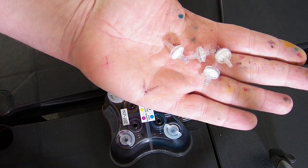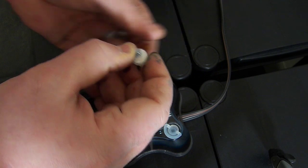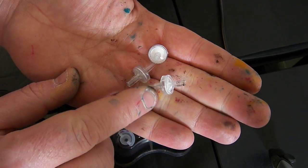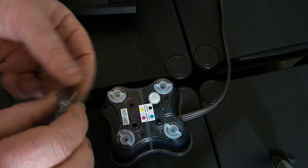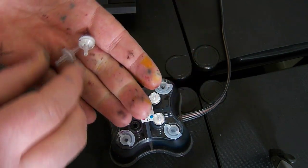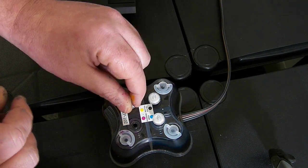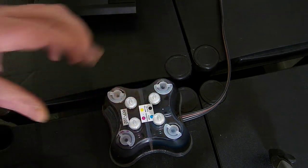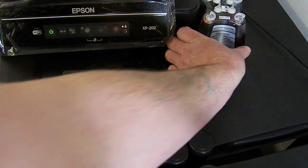In your accessory pack you'll get some air filters that look like this, and they need to be installed with the narrow pointed end facing up. When you look at them, one end is stubby and fat and one end is thin. Install all of them with the narrow pointed end facing upwards. Then pop the continuous ink system over on the right hand side.